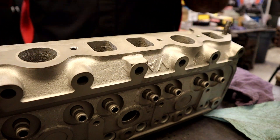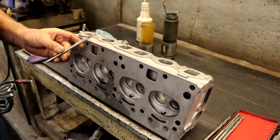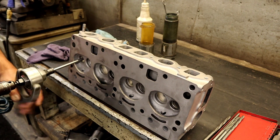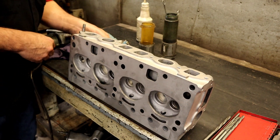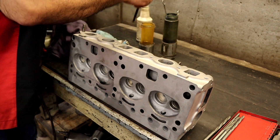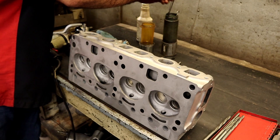This is something you could do at home — really just a knurler and a reamer and you're done. I'm going to change the angle so you can see it from the back side. Here we go — I have some lube on it. Here's our knurler. It's just like cutting threads; we're going to use our speed reducer. You don't have to push — it just screws itself right through and out the other side. Do a few cuts rather than one. Let's not forget to clean the bore.